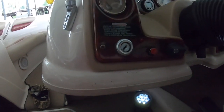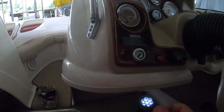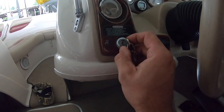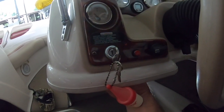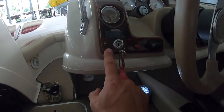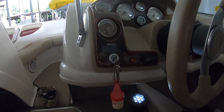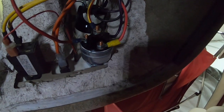You can see how it looks here — it's kind of sunken, so I want to back that nut off a little bit to get it to come through further. Before you tighten it up all the way, make sure it's turned in the direction you want your key. You don't want the key to be upside down and backwards. I want it turned about 45 degrees, about like so, because I want that to be 90 degrees when tightened. This is a faux wood grain piece — every boat's a little different. You don't want to tighten this up too tight; those will crack, especially the older the boat, the more fragile the plastic gets.